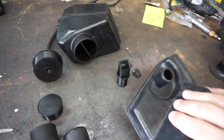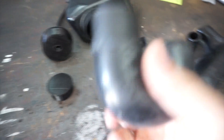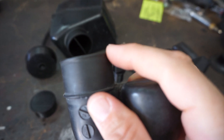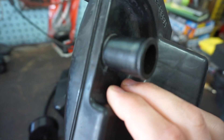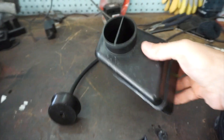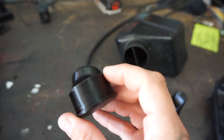Here are the silencers: the one that was on the rear, the one on the front, and the one on the bottom. What I did is I took these inside and I measured the diameter, and I took note of where these little flares were and where the caps were. On these ones here there's a small square locating tab — you can kind of see right here. I went ahead and took measurements on all that and went into Fusion 360 and designed some simple caps.